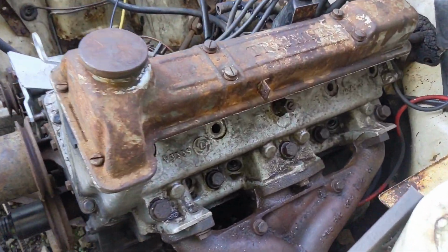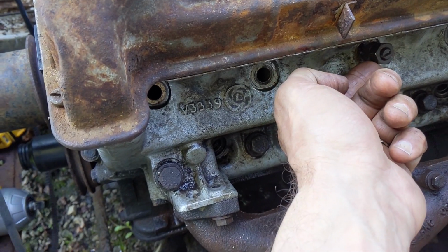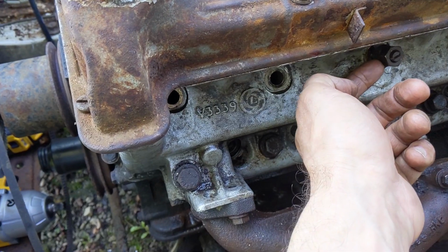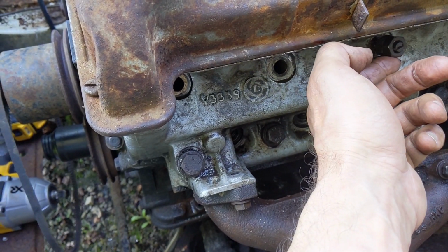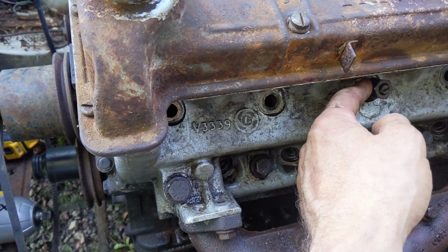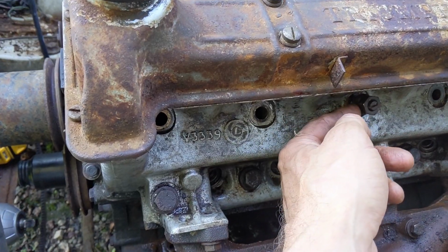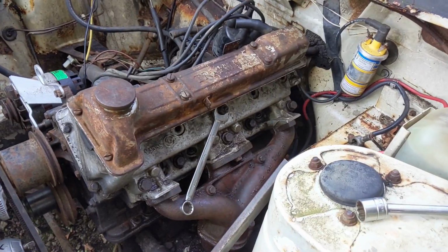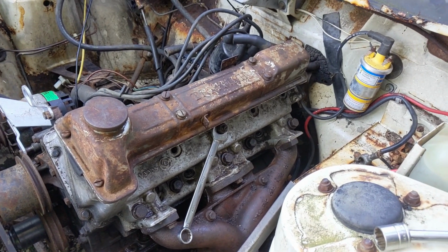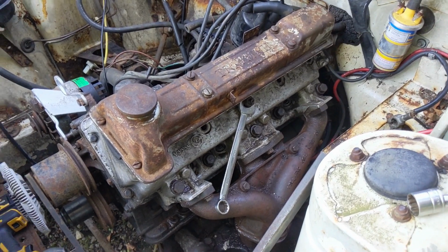We can't quite work out what's going on here. So with the 2 nuts on, when we try to loosen, both nuts are turning together. We don't seem to be able to tighten enough. So we're going to see if we've got a star washer to put between the 2 to hopefully make them grip better. Okay, so some progress because the star washer has locked those together, or feels like it has. We now just can't shift it.